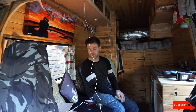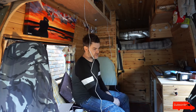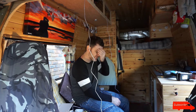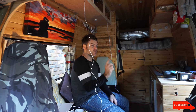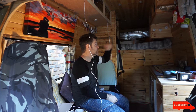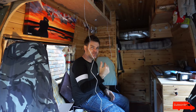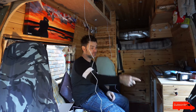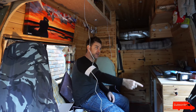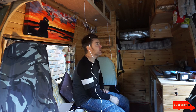Switch! This is where it gets interesting. As you walk in, on this side of the kitchen there's going to be a panel with three switches on. The three switches on the end of this kitchen unit are going to be: the switch for the main lights, a switch for these two lights, and a switch for those two lights underneath the kitchen unit. Because I'm thinking you're going to want independent control - you're not going to necessarily want both of them on. You might just not want these ones on when you're chilling on the sofa. I've got to run the positive from the battery to the switch and then back to the lights, and the earth can just connect onto the negative bus bar that I've got. I've got to run a whole bunch of wires all the way to the other side of this van - this is why it pays to pre-plan.